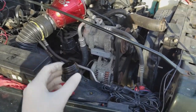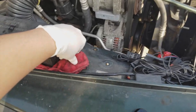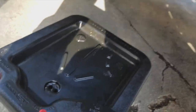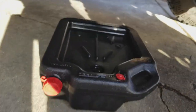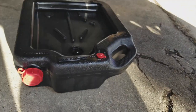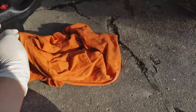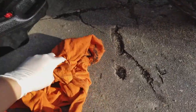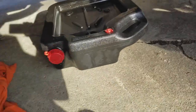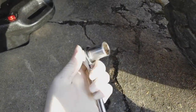Here it is — place the cap down. I've got a little rag right here. Before you do anything, make sure to put your drain tray under your oil pan before opening it, or else it's just going to go everywhere. You're also going to want a little towel or a spare t-shirt, just in case the oil spills so you have something to wipe it up with.